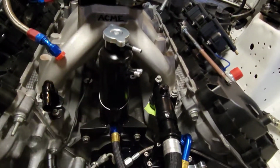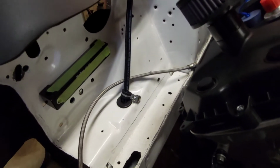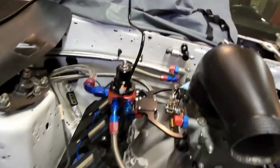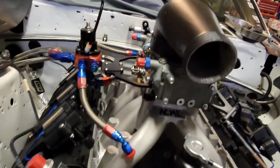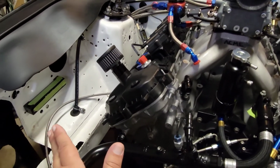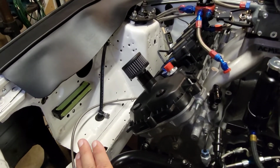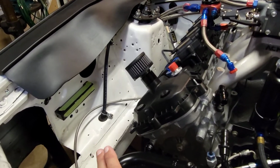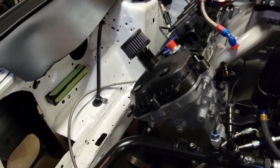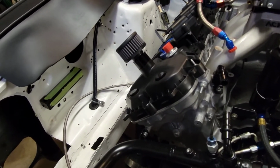A custom reservoir tank. It's going to have all the sensors on that sensor block here, and then coolant pressure and temperature. Map sensor will be back there on the firewall, and I'll have, let me see, we'll measure probably gate pressure, back pressure, oil pressure, maybe trans. I'm not sure about that yet. I've got a bunch of sensors, so I can use whatever I want. But we'll definitely do probably dome pressure, back pressure, things like that,